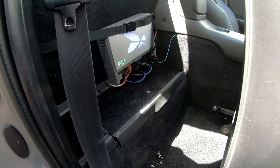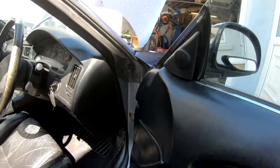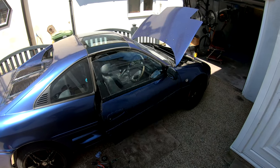I just need to match it up on the other side and then we can go and replace the speakers and put the components in the door. The amp is back wired in — not secured yet because I want to be able to adjust things. We now have sound from the front speaker only, nothing from the tweeters, so I can take the door cards off, fit the crossover splitters in the doors, and connect up the new speakers.